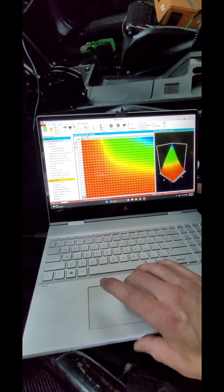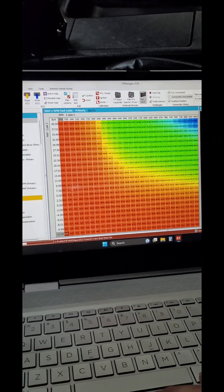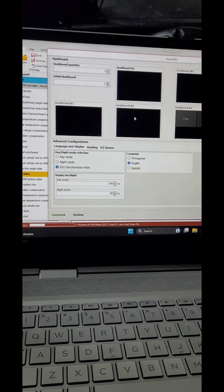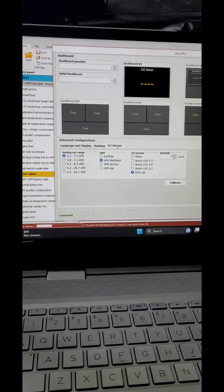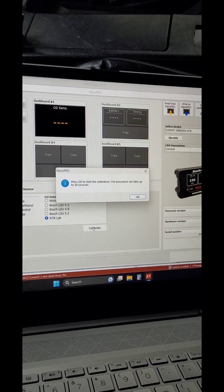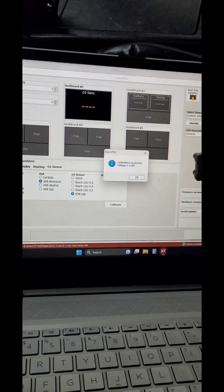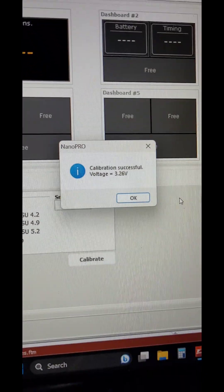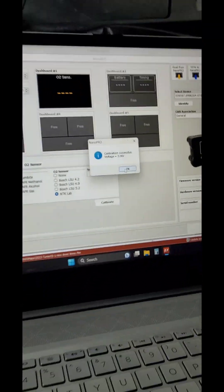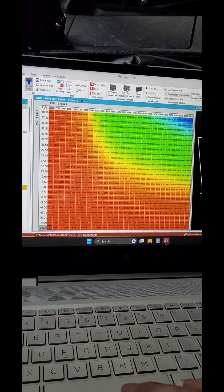That thing's been heating up for a while, definitely over five minutes. Make sure everything is on, go to Nano Pro up at the top, and once it syncs up go down to O2 sensor and click on calibrate. The message pops up saying it might take 30 seconds — click OK and wait. It didn't even take 30 seconds and we get a message that says calibration successful. Click OK, exit, save, and write to the ECU.